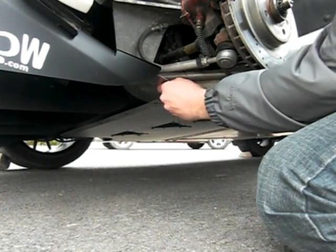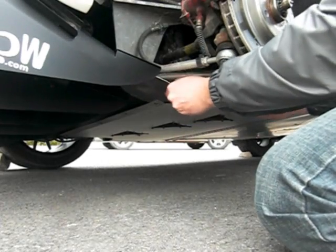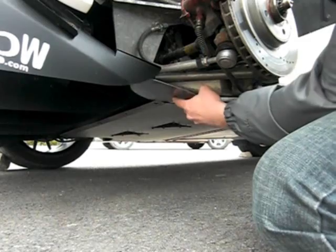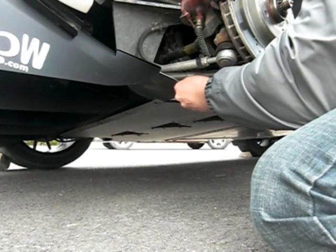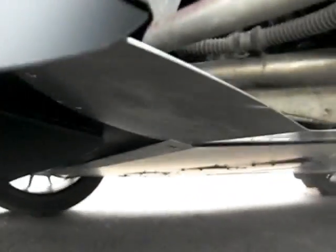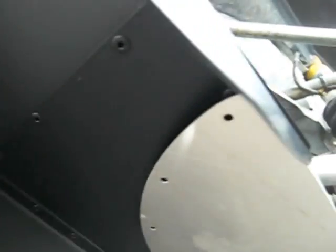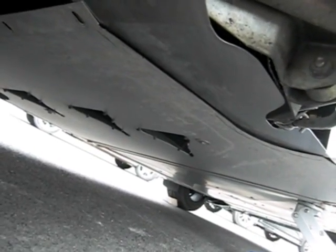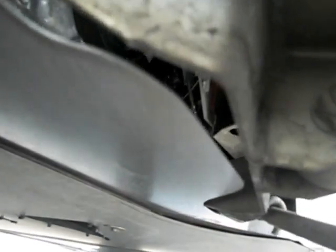Make sure the diffuser rests on the upper side of the Aero Plate, and make sure the under tray is below the Aero Plate. Wiggle the Aero Plate into place so that it bends and the suspension cutouts are lined up perfectly. Notice how the Aero Plates were precisely cut so that the suspension and rubber hoses aren't getting bashed into while the car is jacked up or on a hard, high-speed turn.